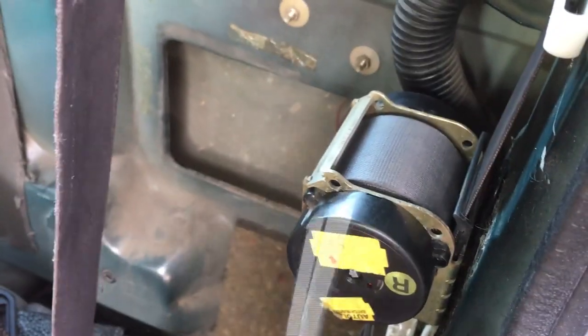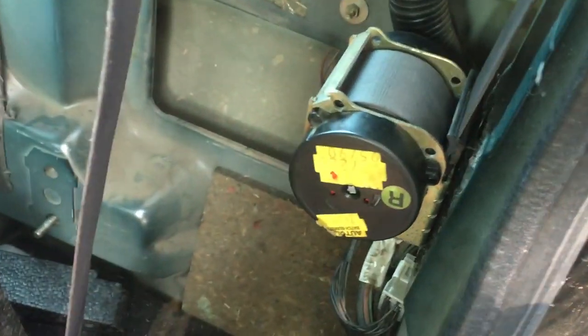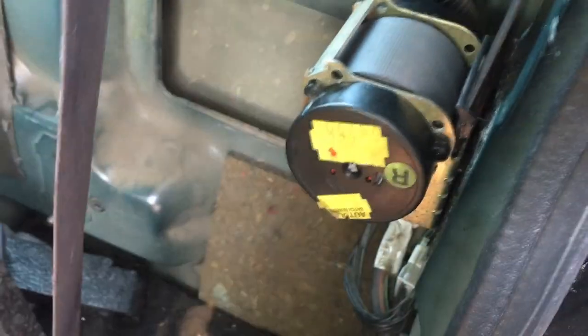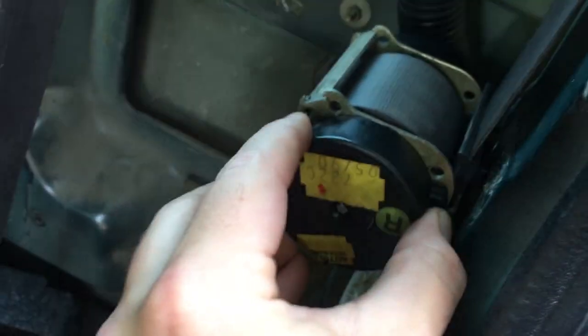This is going to unravel just fine. And if you get stuck at any point or it gets too far retracted, just pop this cover back off with a screwdriver — fit it into one of these slots, pop it off again, and you can unravel it all over again and start fresh. Both of these seat belts were completely stuck — they wouldn't come out at all when I got them in the mail. They're both for the same area in the Land Rover. I thought there was no hope, and both of them work just fine. All I had to do was pop that cover off, take the pieces out — or put them back in actually, because they had popped out — and secure everything in the right order. Make sure the belt was unraveled all the way before putting the cap back on.